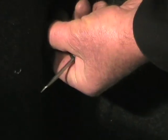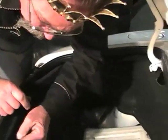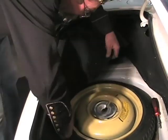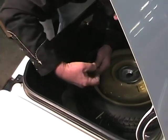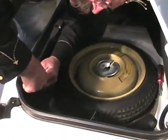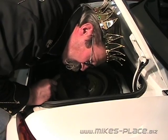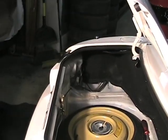We've got a couple of little clips — a little screwdriver just pops them loose. Once they're loose, you can pop them right out of place. There are a few clips hidden in there as well. We'll get those all out of the way and take this panel right out of the car.